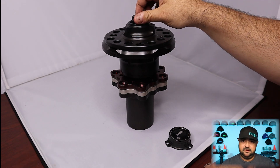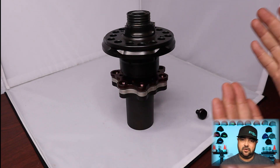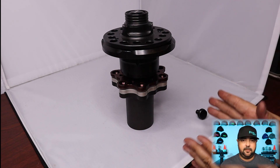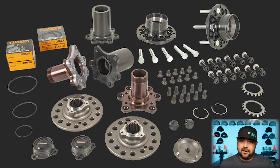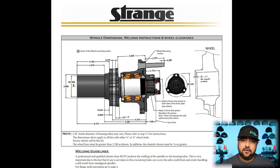Once it's all done you get a nice complete assembly. There is very, very little resistance to the rolling of the car, so rolling resistance is greatly reduced, and you're also going to have the ability to have toe adjustability and camber adjustability. So transferring power energy to the ground is going to be that much easier. I'll have the ability to basically do a rear end alignment. It's not going to be easy - we're going to have to do some work with the axle tubes - but once this is all in place it's going to be lights out. I've owned this car for a long time and it's always been solid axle, so there's going to be a difference whether it's negative or good.